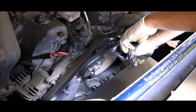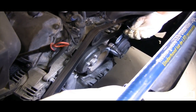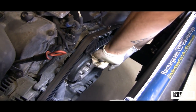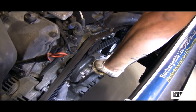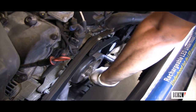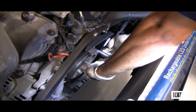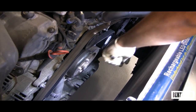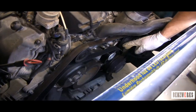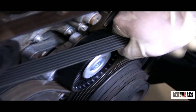Starting with my 17mm and 3/8 ratchet, and I have a rivet to lock it into place. I place the 17mm on the nut on the tensioner itself, then I go towards the left until it stops. I feel for the catch on the tensioner itself, slide the rivet through, let off, and it should lock into place. Once locked, you can see the tension on the belt has loosened and you can slide the belt right off.